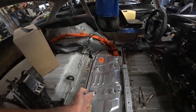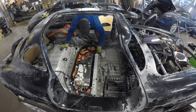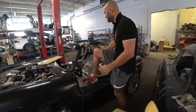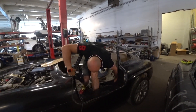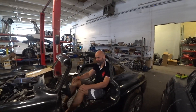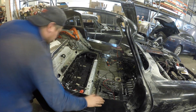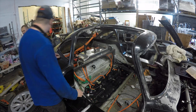But as it always happens with unique projects, a big unexpected problem took place, and it took us almost two weeks to solve. The task was to transfer the charger unit — Tesla has it under the back seat, but in our car this is where the front seats are located. At first it seemed like a good idea to convert rear seats into front seats, but there were two issues: it was impossible to reach the steering wheel, and my head was touching the car's roof, which is way lower than the standard Tesla's. So the charger unit is now placed behind the seat back, and now seats fit perfectly.